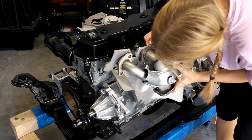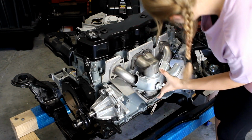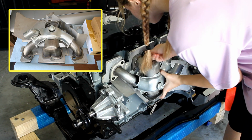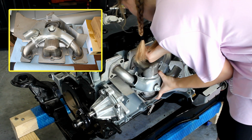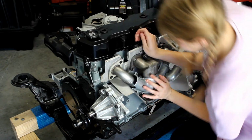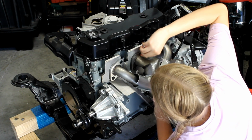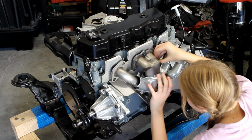With this installed, I then install the new exhaust manifold and heat shield, starting with the top bolt to get it centered. The manifold, heat shield, and dipstick tube are all part of a brand new GM recall kit that is often still available new on eBay. These replace a lot of the older parts and can help freshen up your engine bay. It's compatible with all 5 years of the Iron Duke and will upgrade the 84 to 86 with a newer Thermac heat stove. With the top bolt in, I then loosely install the lower 4 bolts on the manifold.